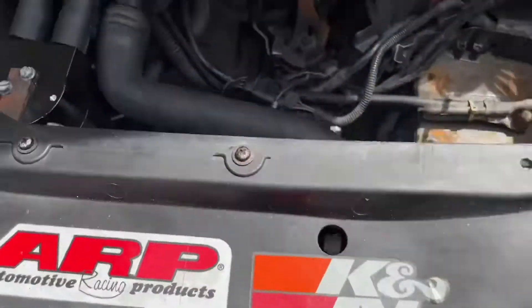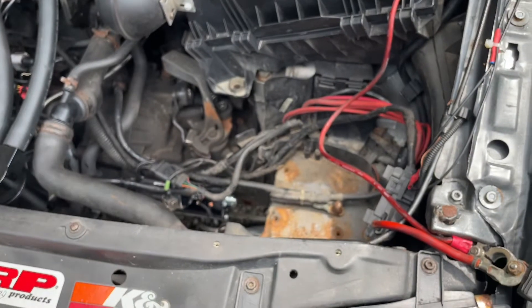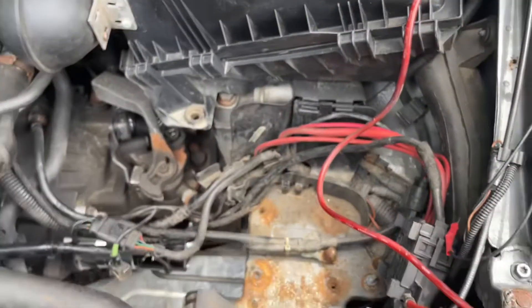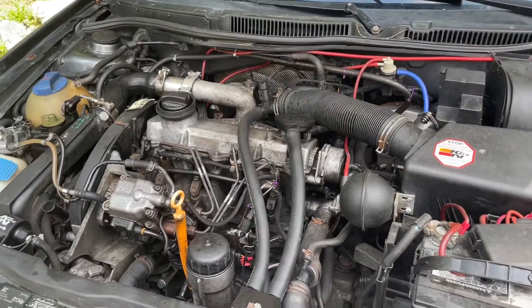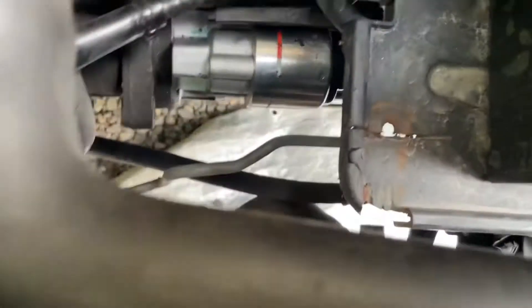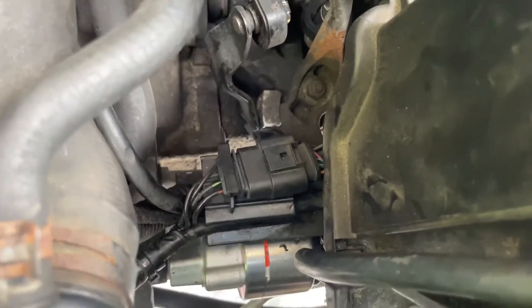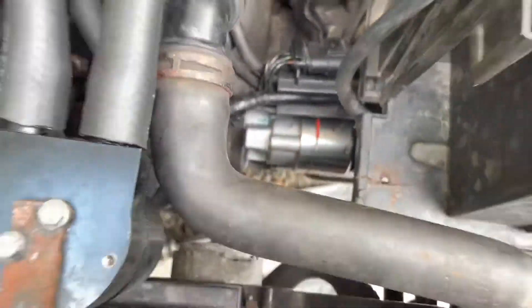Now I'm gonna go to the bottom, snug it with a ratchet, come up top and snug it, attach the battery cable and starter clip, put the bracket back on, battery in, and then give it a little test. Back together — battery's in, tray's in, cables on. You can see the new starter right there, harness is clipped in, all that's taken care of.